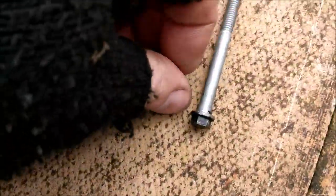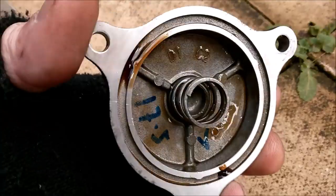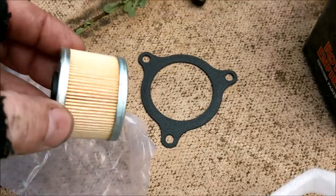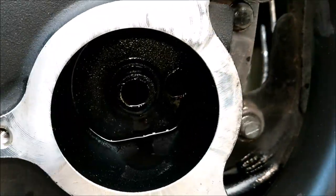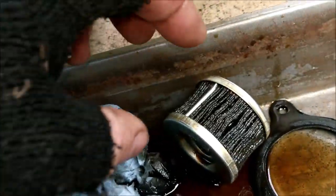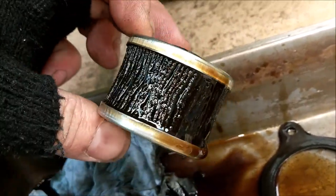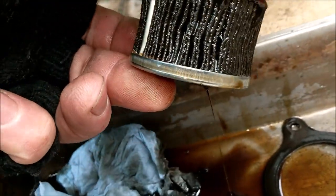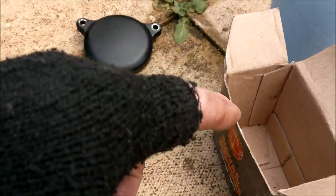On the right-hand side of the bike, you remove this cover. There are two long and two short bolts - the long bolt goes in the bottom, the two short ones go there. Remove that cover - it's spring-loaded. I've given it a bit of a clean up, fitted a new gasket and new filter. Here's the old oil filter - it is pretty grotty in all fairness. I'm going to put it back in the bag it came in, then put it back in the box and dispose of it properly.